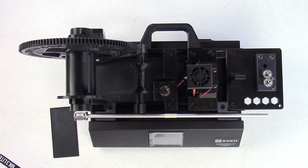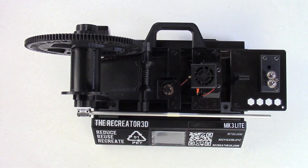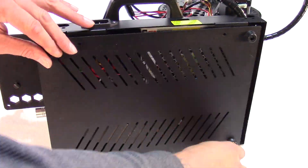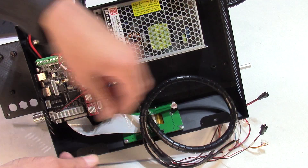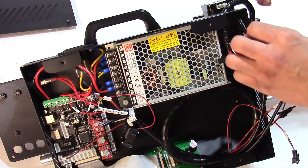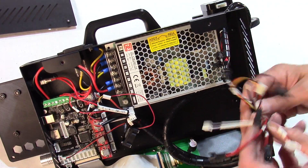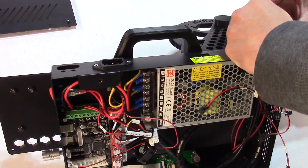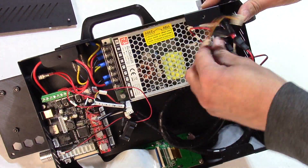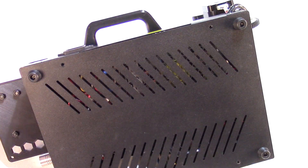Attach the front signage using double-sided tape. On the base section of the Recreator, turn the unit upside down and remove the four screws holding down the base cover using a Phillips screwdriver. Place the wire array inside the hole and tuck the wires to the side. Connect the wire array together, but connect C to D and D to C to reverse the fans. Extend the motor wires out the hole and zip-tie the array to the smaller holes to set the wires in place. Replace the base and four screws using a Phillips screwdriver.